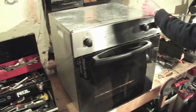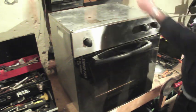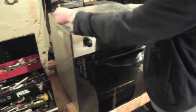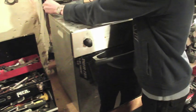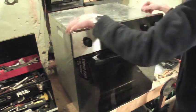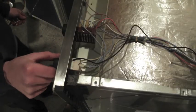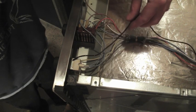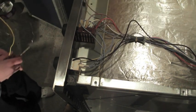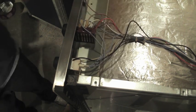The first step is to take off the top cover on your oven. Now that we have this top cover off you can see our thermostat here. You can see that there's two terminals on the back. These send power to the element and then there's this black tube. This goes to the probe that's inside the oven that detects the temperature. It's actually a capillary tube filled with alcohol and as it heats up it expands, and there's a sensor in here which turns on and off your element.